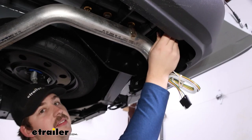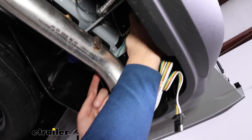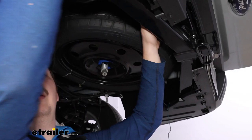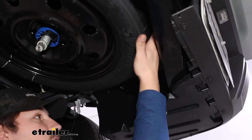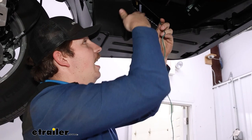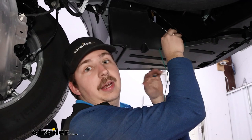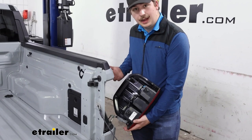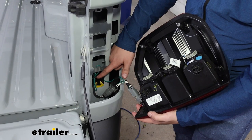Our box isn't fully mounted yet, but it'll live just up here in this cavity. From there, our green wire runs down and away from the exhaust. We'll probably wrap some wire loom around this — it goes up high and away from any moving parts behind the bumper, up above our spare tire, pretty much along where the hitch goes, until we get over to the other side of the spare tire where we fed it through a small gap and out behind the hitch. Then the fish wire comes back through so we can feed this back up through the hole into the cavity to make our connections. Running the fish wire and making connections on the passenger side is the exact same as the driver's side. Once all the excess green wire is tied up and tucked nice and high, we can get the taillight reinstalled.